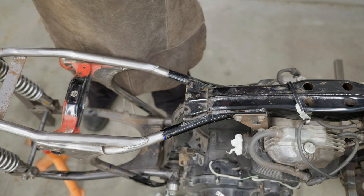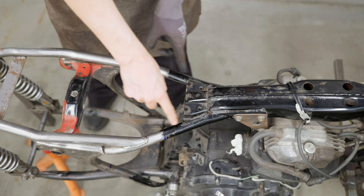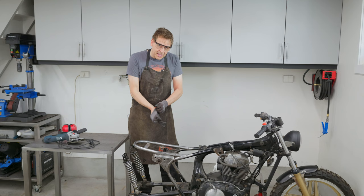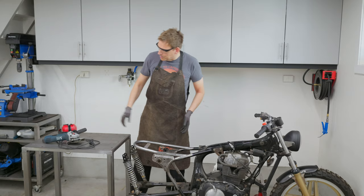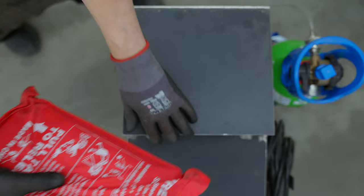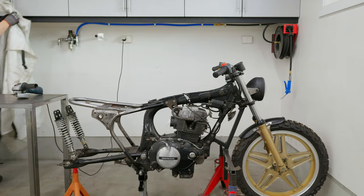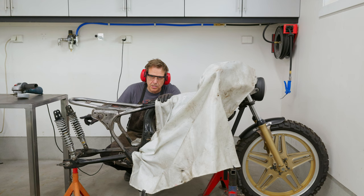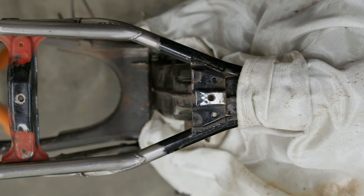And then it's time to start the surgery. I haven't decided yet where I'm going to put all the cuts, but what I do know is that the bracket that holds the tank — I don't need that, I want to modify it anyway. So I'll remove it and then it will be easier to see the pipes and figure out where it's smart to connect my new frame hoop. I almost forgot — I don't bother covering up the shocks because I bought new ones, but I'm trying to avoid getting too much metal debris into the engine.